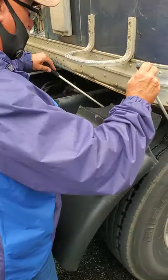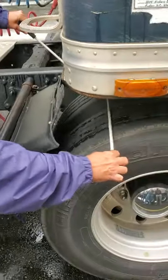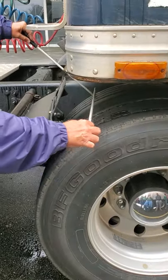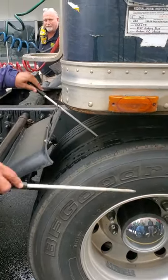Now I'm going to go to this set of tires right here. Evenly worn. No less than 2/32nds on your back tires. I'm going to check my inner wall, outer wall, inner wall, outer wall.